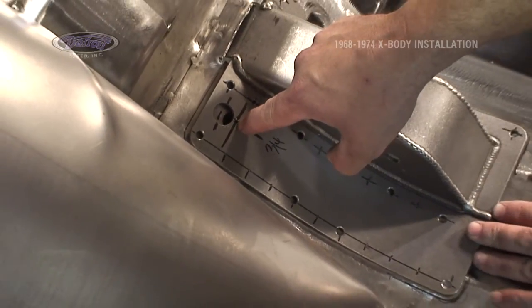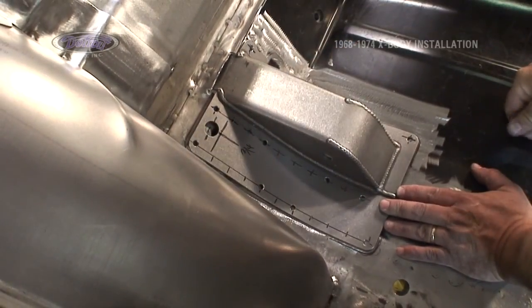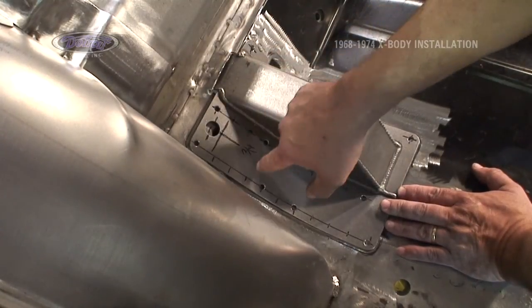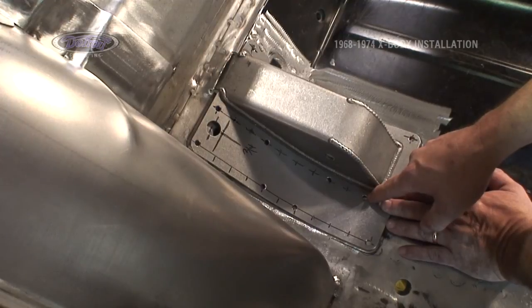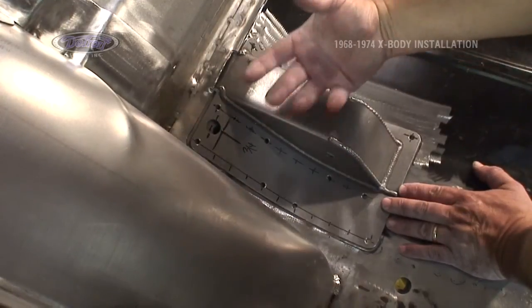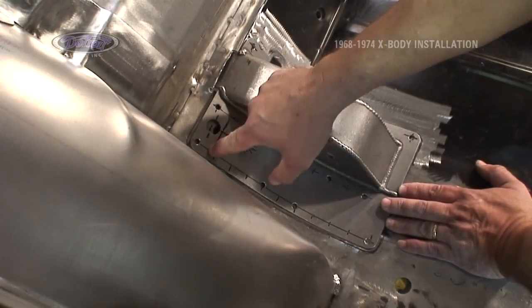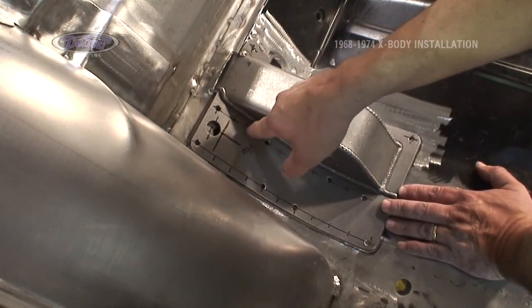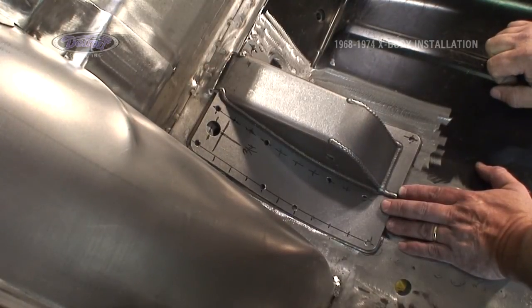I'll move down. This is my new center hole. I'll weld this hole up and put a hole here to accommodate for it that way. I have already started a few of my initial weld plug holes in the mount because I had to use that to hold the floor down at one point when it wasn't attached. Now, while I have it out fixing this, I'll go through and drill all these holes at the same time and have everything ready to go. When we come back in, we can weld it in place.